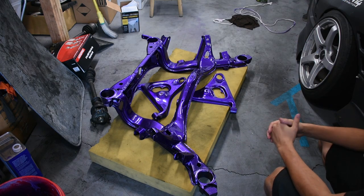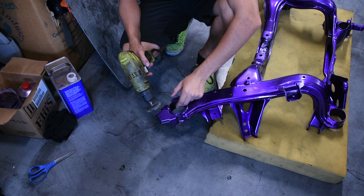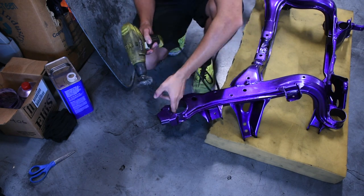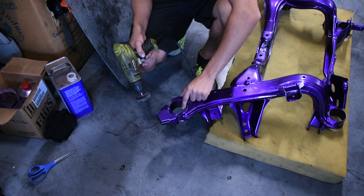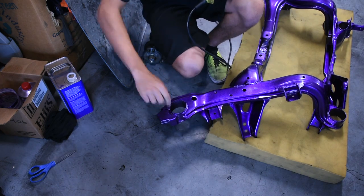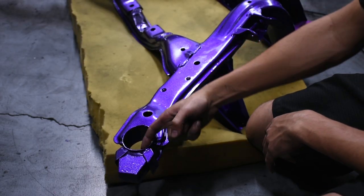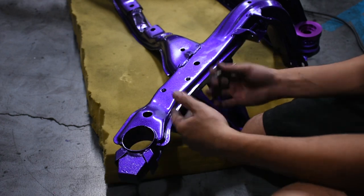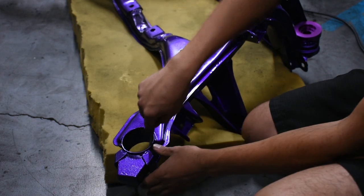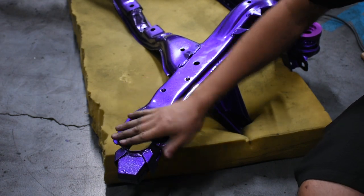So now I'm going to start reassembling everything and pressing in the bushings. Since I'm going to be pressing in the bushings I just want to make sure that the surface in here is clean — especially since it's just been painted so there has been some overspray inside. So I'll take my wire wheel on my drill and just clean out the inside surface to make sure it's clean and prepped for the subframe bushing to go in. All the overspray is taken off and it's all clean and good to go. Moving on from the wire wheel, I can feel that there's a small lip over here. What may be necessary depending on how your subframe is, is a small file to file this lip down so that way the subframe bushing can actually slide in from the top. That feels pretty good now and there are no jagged edges for the subframe bushing to get caught on.